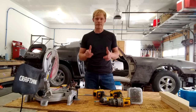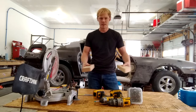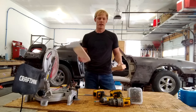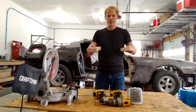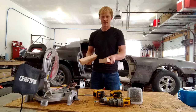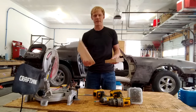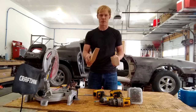Then determine how long you need them to be — 14 inches works fine for both front and rear for my car. One way to figure this out is to take two pieces of two-by-four and while the car is sitting on the ground, put them in the front and back of the tire and measure it, then maybe subtract an inch or two. I went with 14 inches for this car. Once you have your height, width, and length figured out, write it all down, figure out how many pieces you need to cut, and you can figure out how many two-by-fours you need to get. I will have a materials list on the website — the link will be in the description at restocar.com.